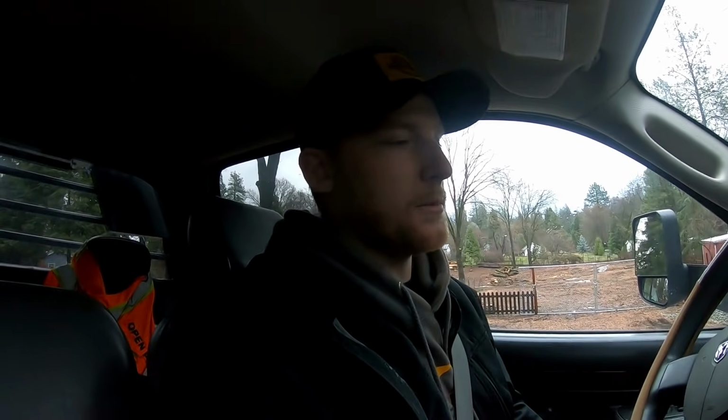Everything seemed like it was working just fine. It didn't have any hiccups. Exhaust brake plus the load leash. Load leash seems like it's doing better now that I did the little bit of tweaking. Redialed everything. Truck's running smoother. It's starting a little bit easier with the valve lash adjustment, so thousands count. That is definitely a fact right there.